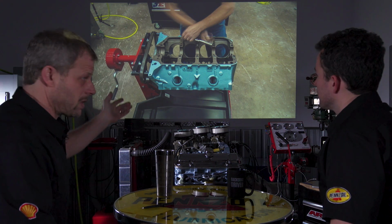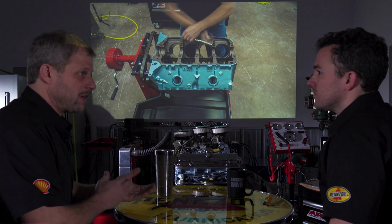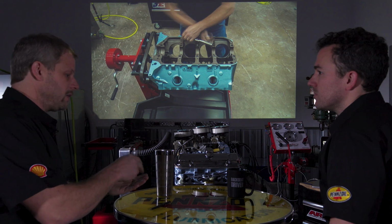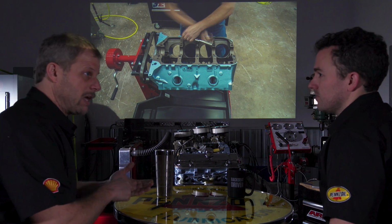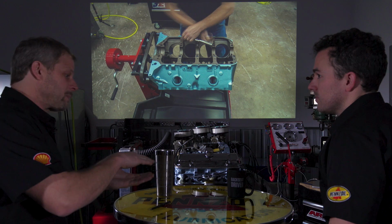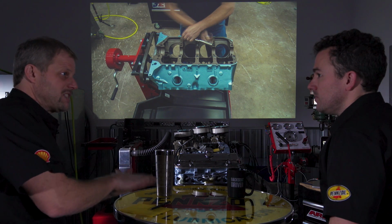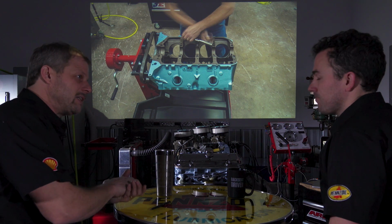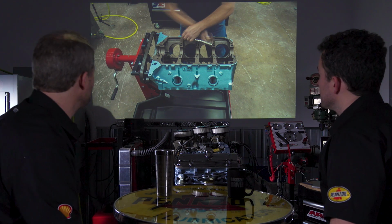Gotcha. And that's also where it comes in when fastener manufacturers specify, this needs to be dry, or it needs to be oiled, or it needs my lubricant. That's why that is there, so you get the clamp load, ultimately even some bolt stretch, which helps that clamp load stay, or that part stay tightly together and not move relative to heat or changes in temperature. Cool.